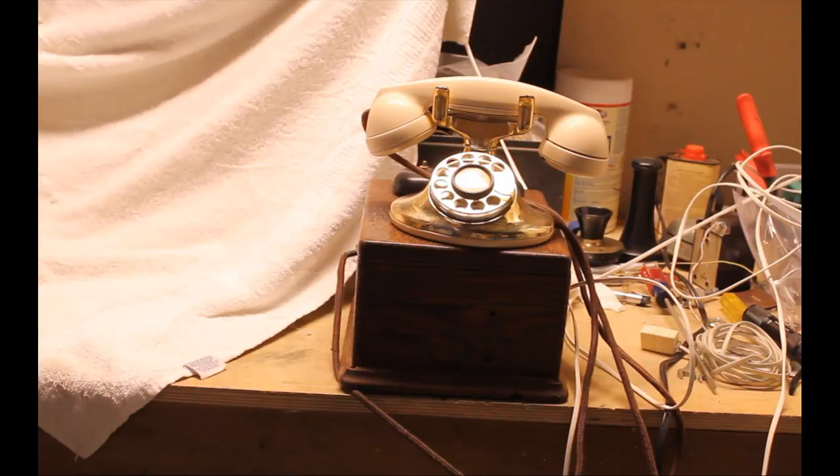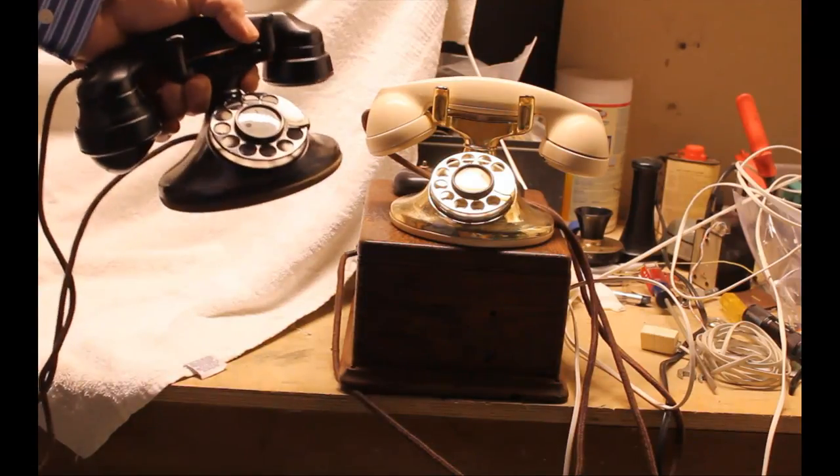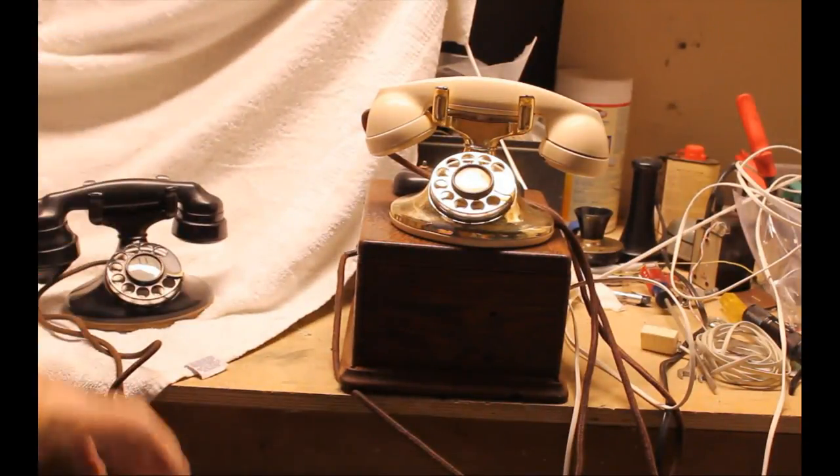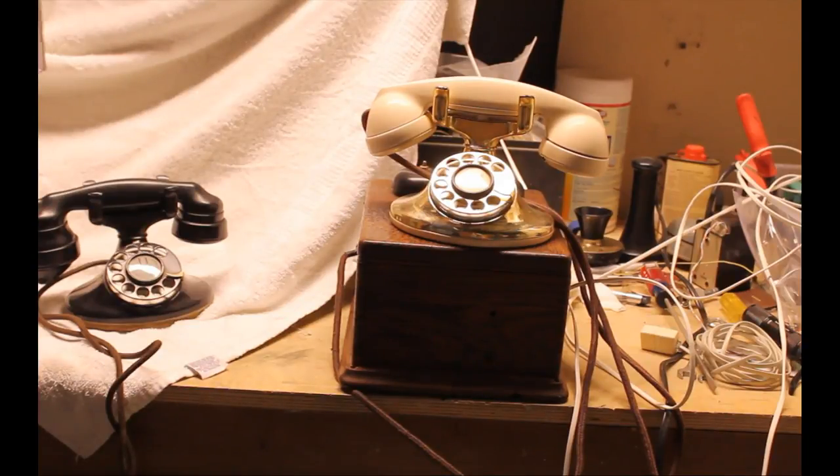They plated the phone — a base that they had from existing stock of their zinc alloy 202 D1 body mount telephone. What I mean by that is the oval base — some people refer to it as the oval base, but it's commonly referred to by others as the D1 that has the D1 marking on the back. The D1 had several types according to handset mounting at the time. They had a 206A, a D5 type hand mounting set, and a 207A type hand telephone set. Those came with types of wiring for side tone and anti-side tone, service for subscribers and that sort of thing.